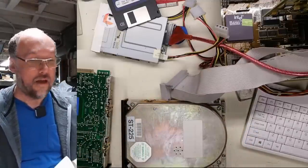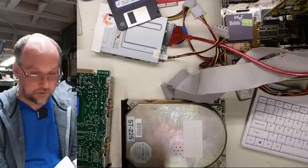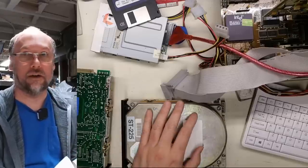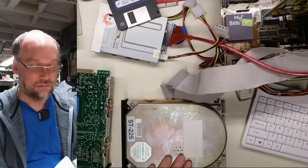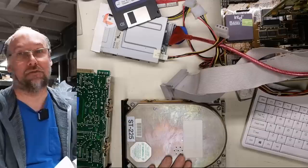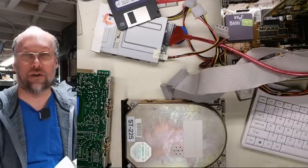like MFM drives. And of all of the ones I've had come through, I always check them, do a full thorough test on them. If I can low level them, I'll low level them, run them through a full diagnostic with a surface scan and whatnot. I think I have about 7 or 8 drives that work. The rest have all been broken in one way or another, and I've had to recycle them. It's just the unfortunate nature of these old hard drives.